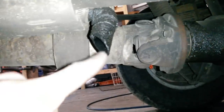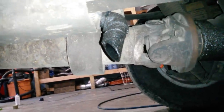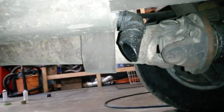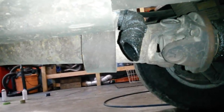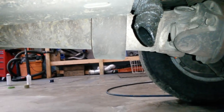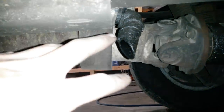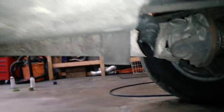And I'm working on my Blackwater engine rebuild right now, and it had a blown number 7 cylinder. It was actually blowing out burnt oil constantly. I was going through like a gallon of oil every 1,000 miles coming out that hole, because all the burnt gas and blow-by will end up coming out this hole. If you've got a healthy truck, you'll see a light haze. Shouldn't be puffing, it'll just be a light haze.